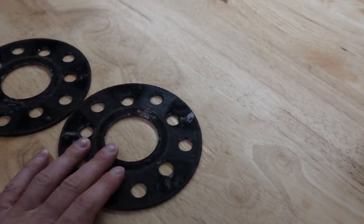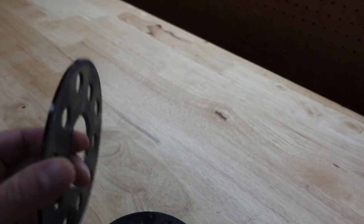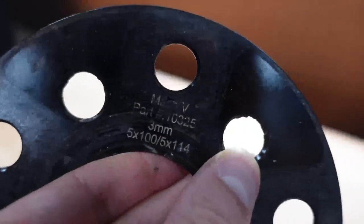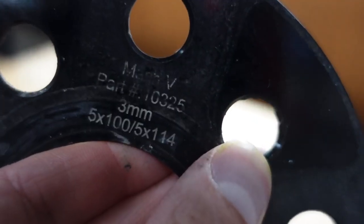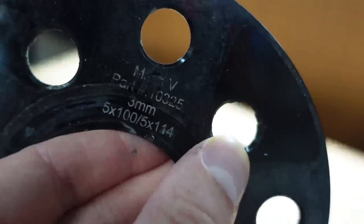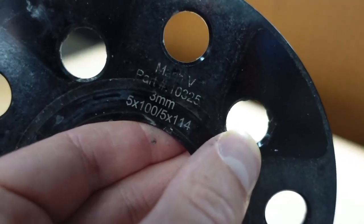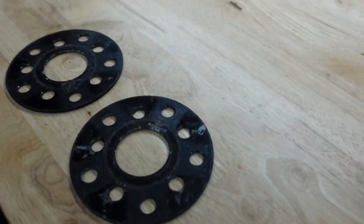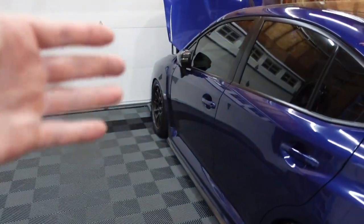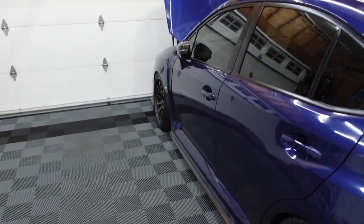But so the spacers that we are going to be using, I got these a while ago when I had my Enkei RS05RRs. They are 3mm spacers. I got them from Mach V Motorsports. I'll leave a link below if you guys are interested. They're kind of worn off, but it sort of says Mach V, you can't really see it at the top. They're 5x100 and also 5x114, so either bolt pattern works, and you can see 3mm. I have four of these. I'm just going to use two right now for the fronts to see how that works. So let's go ahead. Let's get the front driver wheel off, throw the spacer on, and see what we think.